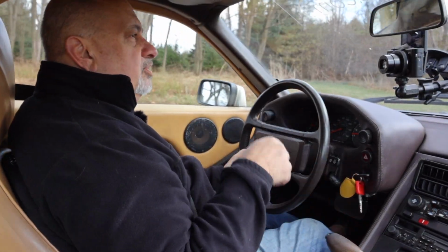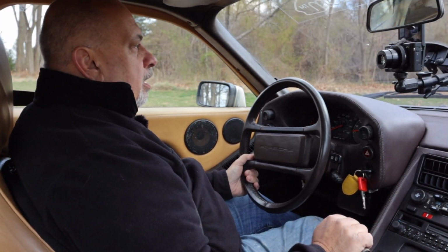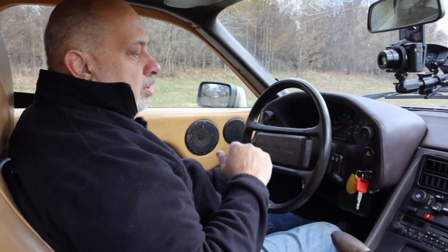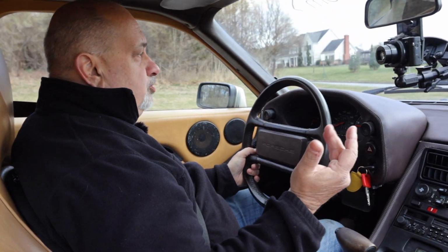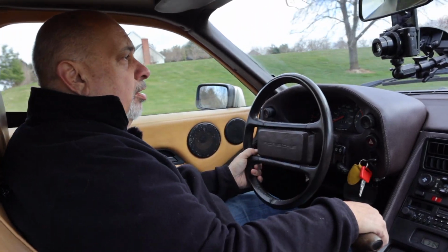So one of the things wrong, you can hear it right now. I'm at 1,200 RPM. The throttle's sticking. I have a new cable for it, but I have to constantly tap it down to get it back to idle. The throttle is slightly frayed at the connection, and I need to take care of that. So an upcoming video will show me redoing the throttle cable. I ordered one about 2 years ago and never got around to putting it in, but now I'm getting to the point where it's just annoying to drive the car with a stuck throttle.